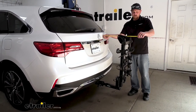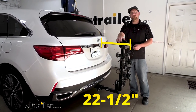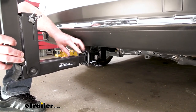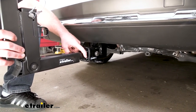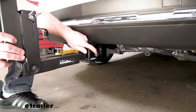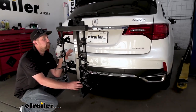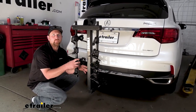In this position, it's only going to be about 22 and a half inches. So with it like this, I really don't see it giving you any issues when you go to pull into your garage or even a tight spot. The rack is going to work with those 2-inch by 2-inch receiver tube openings like we have here today on our MDX, but it can also work with the smaller 1-and-a-quarter by 1-and-a-quarter hitches, so it gives us a couple of different options. It's going to come included with an anti-rattle bolt, and that's going to eliminate any slop or play at the connection point — keeping the ride inside your MDX nice and quiet and providing a smoother ride for your bikes as well.